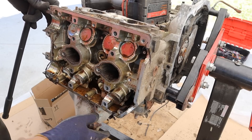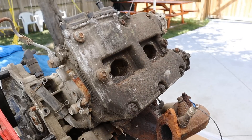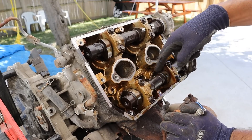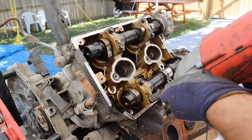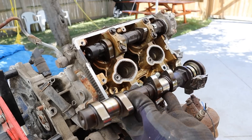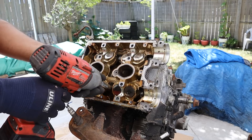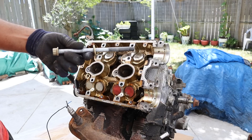Before I get this head off I've got to turn it over and get the exhaust side. But first let's get the other side head bolts loose. Here we are on the passenger side — pulling off the coils first. Removing all the 10mm bolts for the valve cover. This side looks a lot darker than the other side. Same thing here — I can rotate the cam very loosely. This one is actually stuck on the tip of its cam lobe. Look at the overheating on here — you can see this area has been warmed up due to lack of lubrication. A little bit of scoring. The camshafts actually look pretty good overall, just slight discoloration, probably from some overheating. Now I'm going to knock off the head bolts on this side. If you're going to be rebuilding your Subaru, definitely get new head studs — these were not the best from the factory.